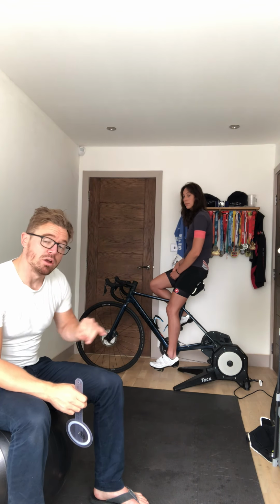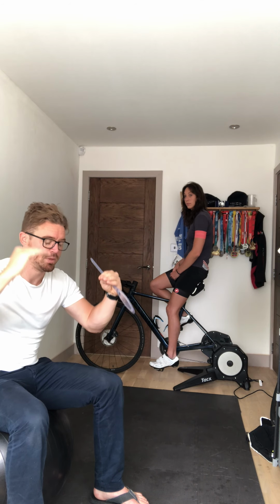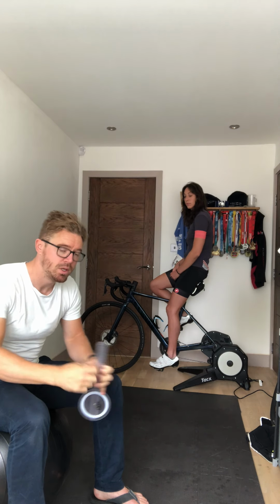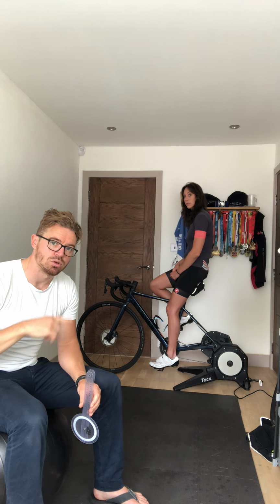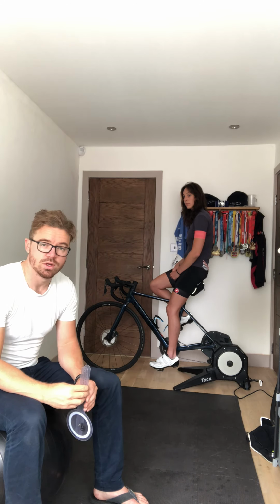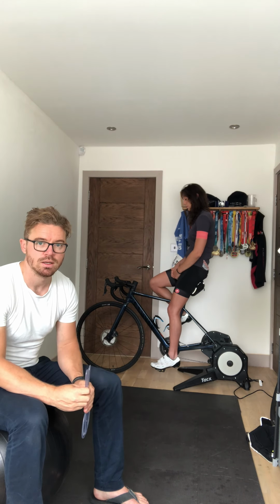The other thing that people worry about with that is slamming their stem. So you've got your saddle height and your stem height here. And the difference between the two obviously gives you a slightly better aero silhouette if you're reaching down. That is majoritively avoidable, and it's much more important that your general mechanics of your legs and your pedal stroke is correct, and then set your bars in a comfortable zone where you can sort of bend into your arms and then use your drops for the aero position. That's the way a bike should be designed, and that's where you should ride.